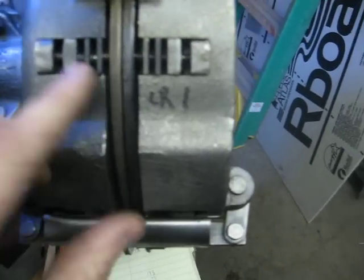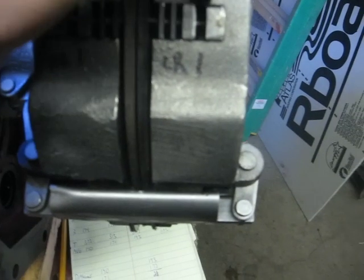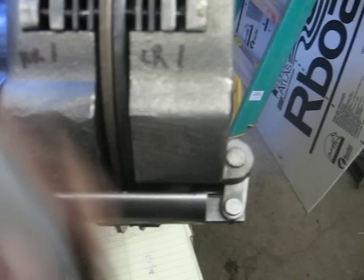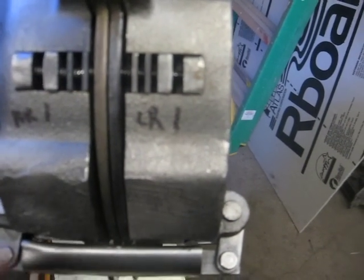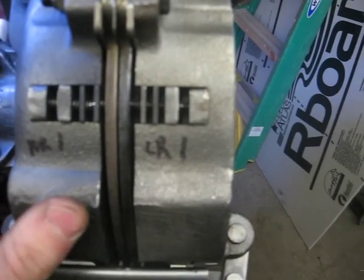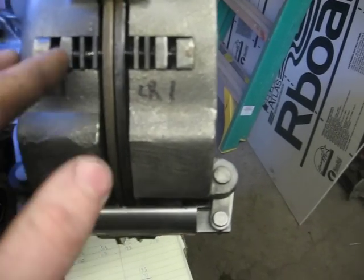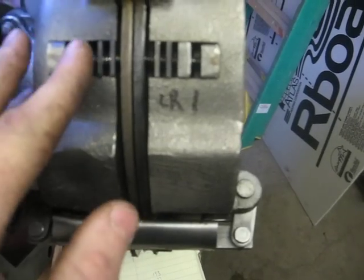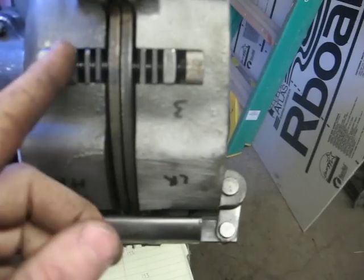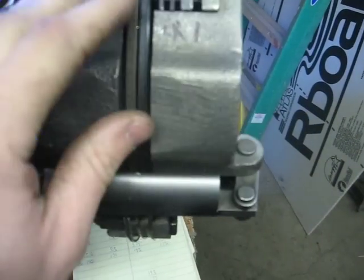When it comes to measuring: you're going to release the clutch pack, put it in neutral, and you can see the plates are loose. You're going to measure this distance right here. You're supposed to use a split bore gauge and a micrometer - I have a micrometer set but not a split bore gauge, so I just used a caliper. You measure this distance with it released, then shift it using a pry bar in the shift collar. Once it's shifted and the clutch pack is applied, you measure this distance again. You've got to do this at all three locations, both released and applied.